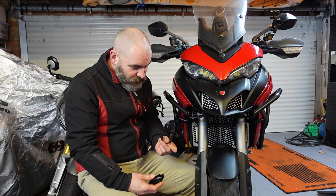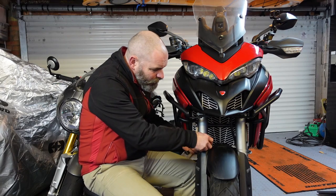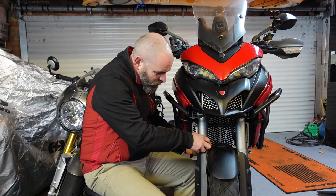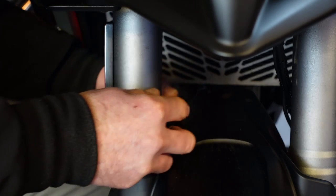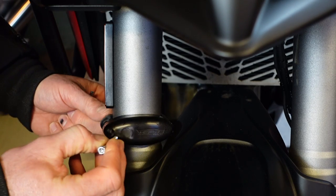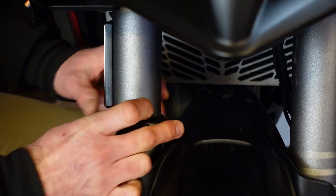One thing I've just noticed is that if I use strap two in notch A as the instructions say, it doesn't really reach around. But I've discovered that strap two in notch B seems to work, so I think I'm going to use strap two in notch B. I'm not sure if that's a typo or what, but it's an easy fix. It also looks like I'm going to need the longer screw. Apparently you're only supposed to tighten the screw to 1.5Nm of torque — I reckon you should stop when it just gets to the point where it starts becoming difficult to slide the unit round the fork by hand. So that's around about where I'm at, and that's it all done.